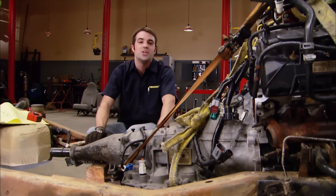Welcome back to the shop. With our engine and transmission swapped in, the distance between the output of the transmission and the rear axle has changed, calling for a shorter drive shaft. Like we told you earlier, for stage one of this conversion we're going to keep the automatic. But when we go to a more high-performance stage two, we're going to swap in a manual. So rather than buying a drive shaft now and another one later when we go to stage two, we're just going to try to shorten the stocker and save a few bucks.